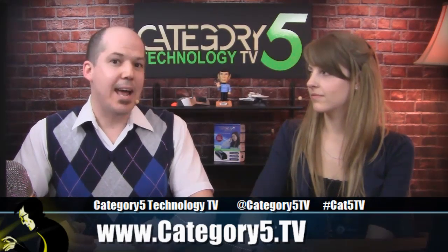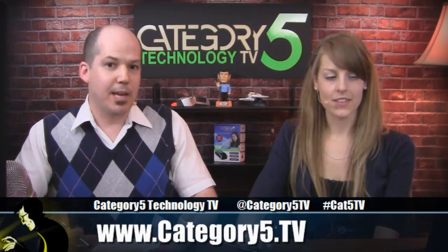I actually had a chat with Phil Priest — he is a data recovery technician at pesdatarecovery.com. I'll put a link in the show notes for episode 282. He made the comment that unless you have that decryption chip, you can't get the data off. So the one time you really want to get your data off that drive, you can't. The data recovery technicians say they can't do it because the data is garbled — the chip got fried in the power surge. They call up the manufacturer and ask if they have a compatible chip for that serial number. If it's available, it bumps up the price and takes a lot longer. If it's not available, your data is gone forever.